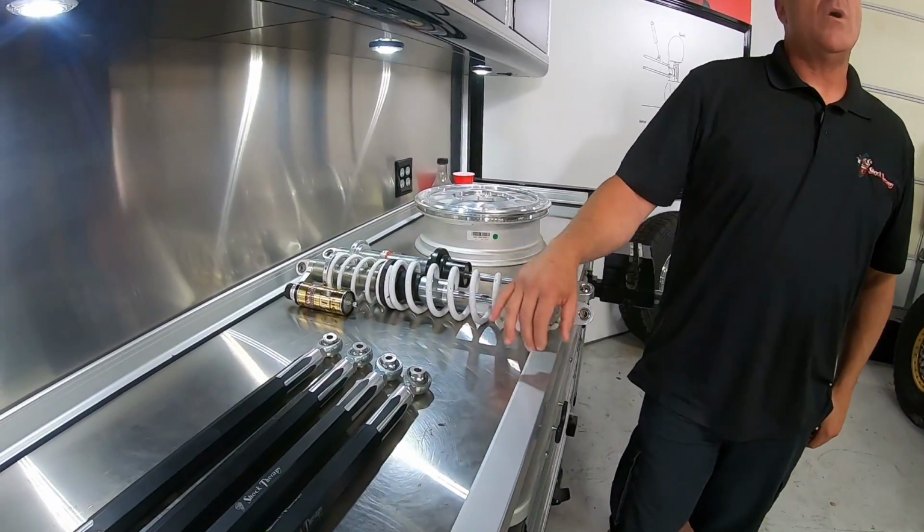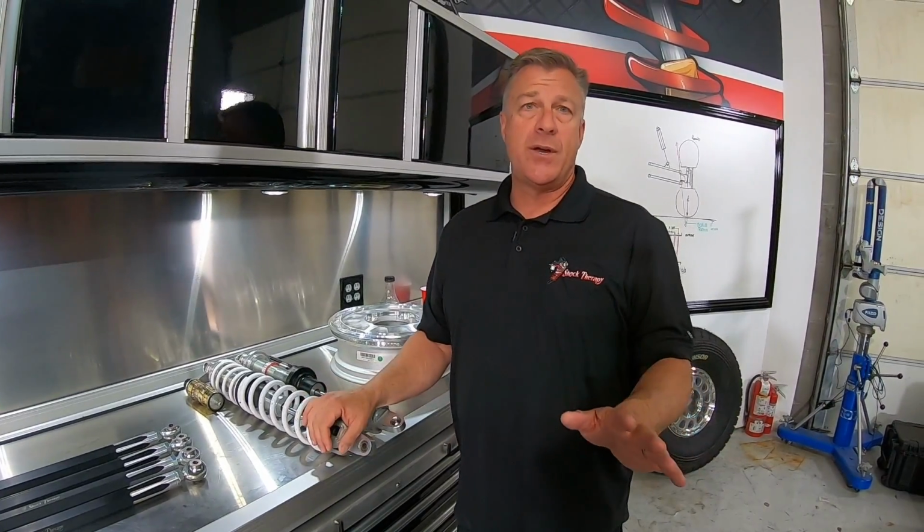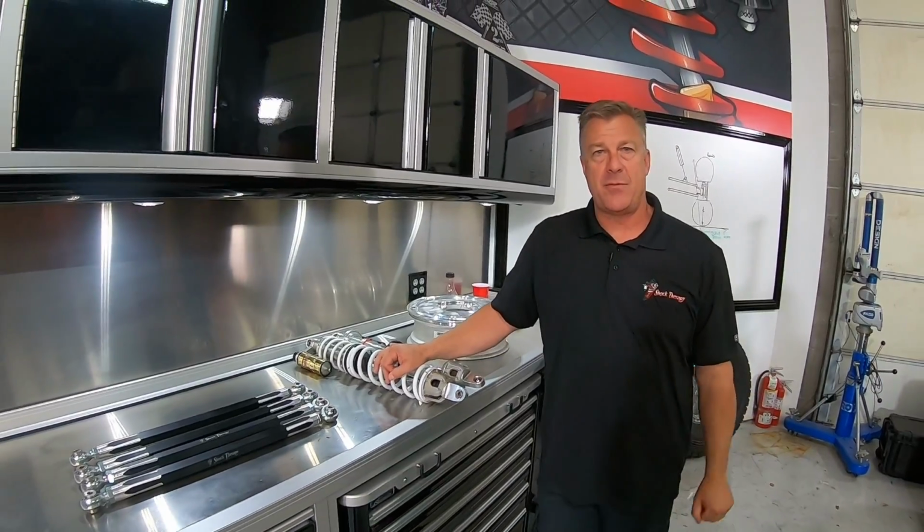One from Elp Square. How much does the bump steer delete help with the feedback? Okay, so bump steer delete specifically on a Can-Am. A lot of Can-Ams have this issue. Not all of them do. We try to actually push people to measure how much bump steer they have before they do the kit. But if you want to compare feedback in the wheel to wheel offset, first I'll tell you that the bump steer delete will get rid of 80% of the feedback in a Can-Am that's relative to the toe change. It won't get rid of all of the feedback when you're in whoops with a factory rack and pinion, because the factory rack and pinion can bind up a little bit, and that comes in the wheel with a little bit of feedback. But when you do the wrong wheel offset on the front of a Can-Am, you'll have 10 times the amount of feedback that just bump steer gives you. So our BSD will cure the feedback from bump steer. It will not cure the feedback from the wrong wheel and tire.